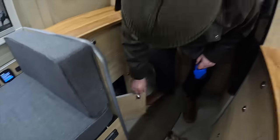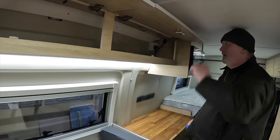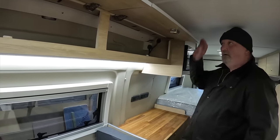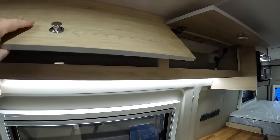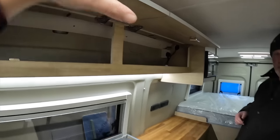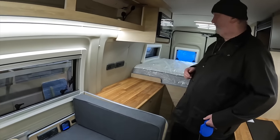Monster battery. And remember, the hinges are motorhome hinges, so they're stay hinges. For it to be a stay hinge, they have springs. So just remember, on that last bit, they flick. Not so bad on the wall cabinets, but there's a spring in the motorhome hinges. You don't feel it so much on this because you've got the weight of the door. But on one opening sideways, you'll notice just towards the end, it does snap a little bit because of the spring. Right, that's perfect.